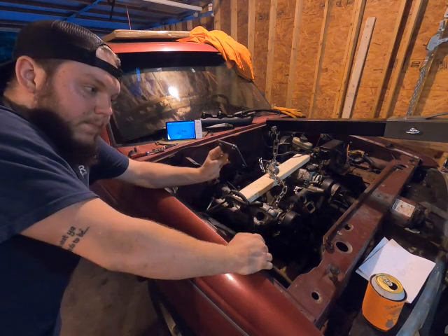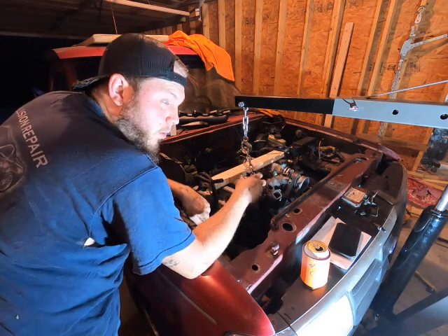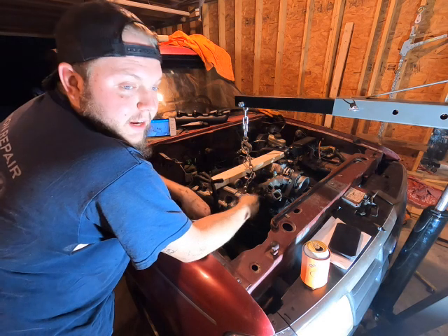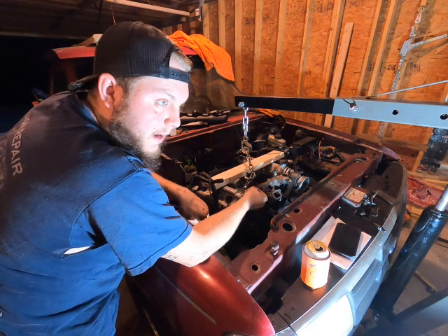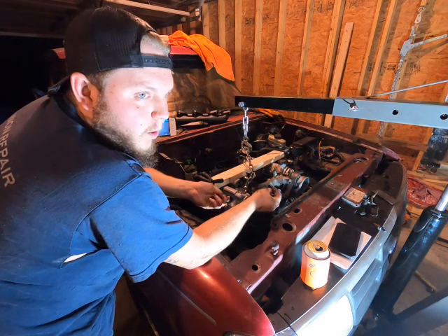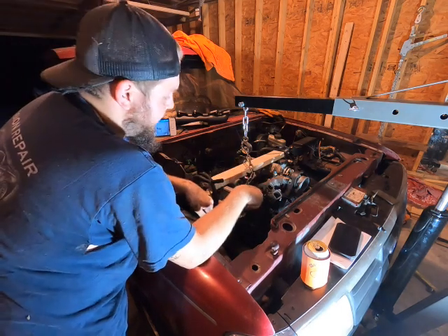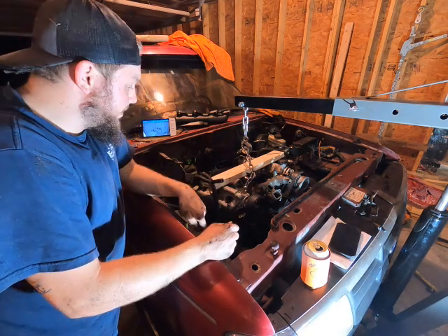Since I changed to just a quarter-inch plate instead of the actual motor mount, I've shrunk the distance between the bolt hole and the block, so I need spacers between each bolt — I've got three on each one so far. Because I am unable to follow a simple template that's right in front of me, the holes are out of whack. There's one hole on each one I need to widen out — we'll hit it with the carbide bit eventually. For now, we'll put three bolts in on the other side, make sure the engine's level, then start taking measurements and hopefully start welding.